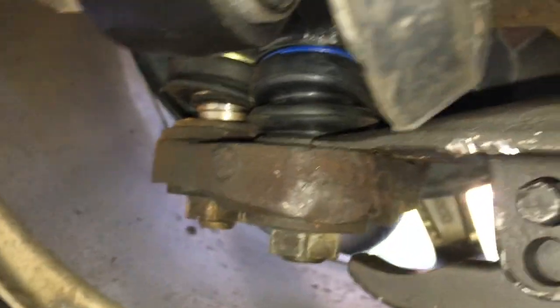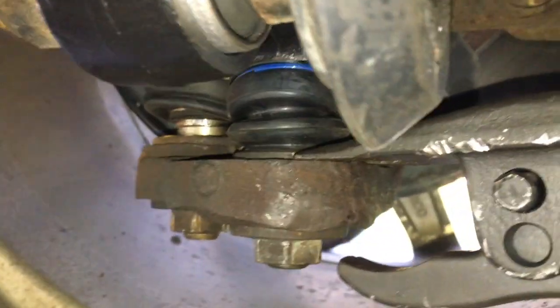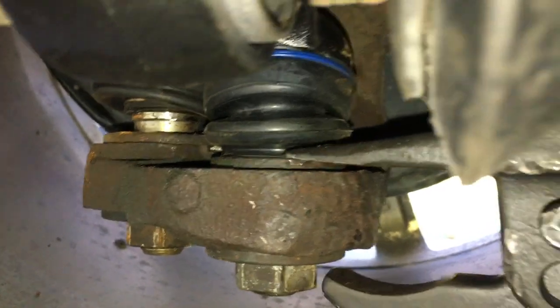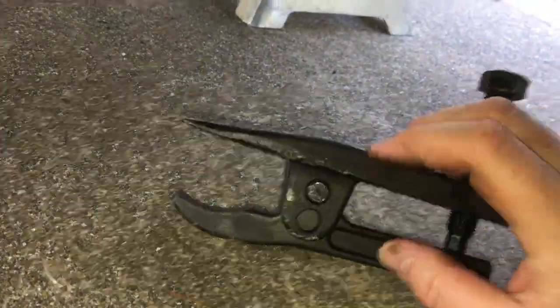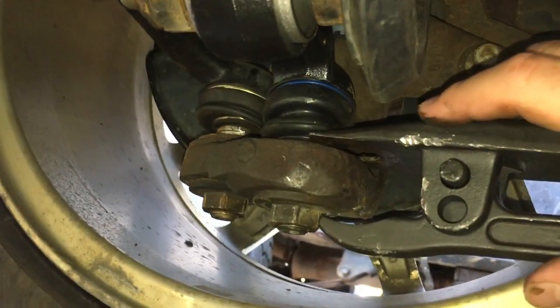Sometimes you've got to pull them off the old ball joint because the new ball joints don't come with them — since the whole control arm is one piece. The Harbor Freight tool fortunately will go over that. When I do it, I take some pliers and rip the old rubber out so I can get the tool in there — that gives you just enough space. You can slap the tool in like that. Set the tool with the pin in the higher position; tap the back of it with a hammer and it'll slide over. Then get the anvil over the stud and take the nut off.